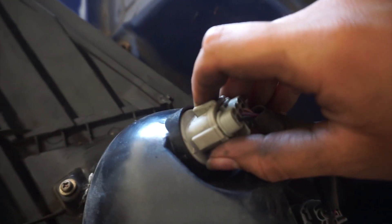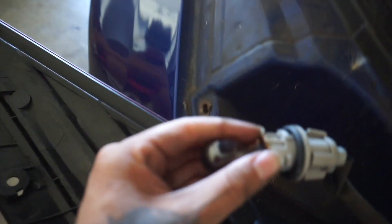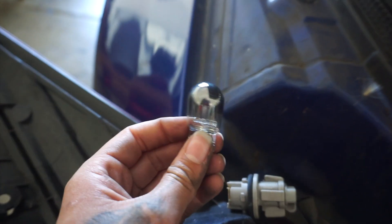When I was watching videos, this one is supposed to be the brake light — the bigger one. So we're going to take this one out. This is supposed to just sort of twist out. This is the bulb that we're going to be replacing, and then the bulb is supposed to come out pretty easy — you just kind of pull it and it just kind of pops out like that.